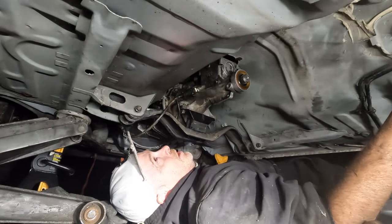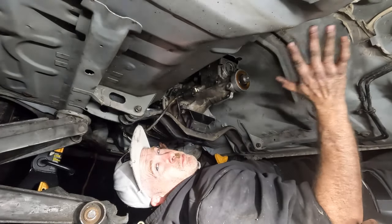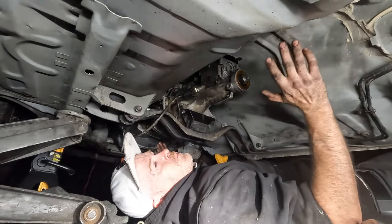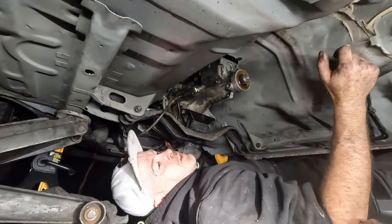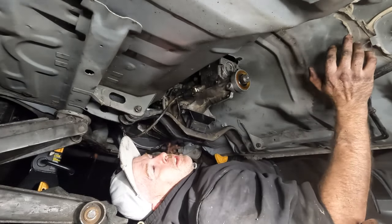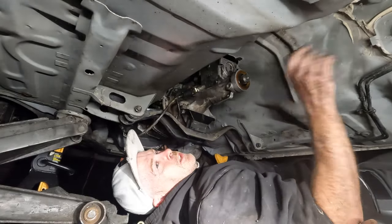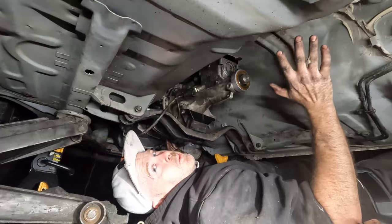we're almost there. And the thing about this car is I want to try and get as much of it all together because it's a fresh motor, and once it's running, need to do the break-in cycle, so some varying RPMs for about 20 minutes, and I just want to make sure that everything is good and things aren't going to rattle loose or, I don't know, fall out, who knows. So I just want to try and get all of the nitty-gritty stuff out of the way so that way when this thing fires up, it's pretty much ready to roll.